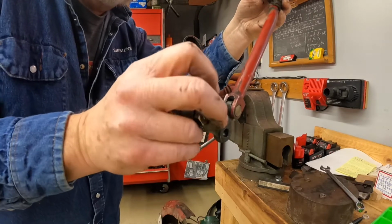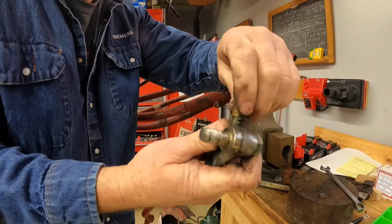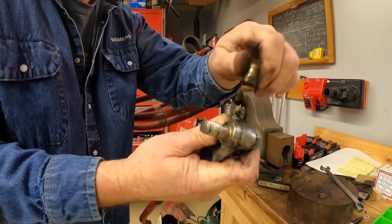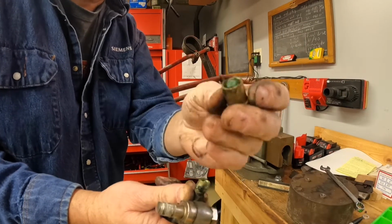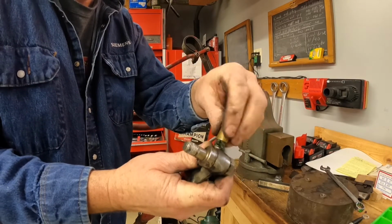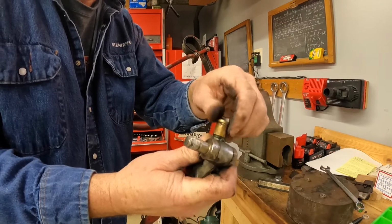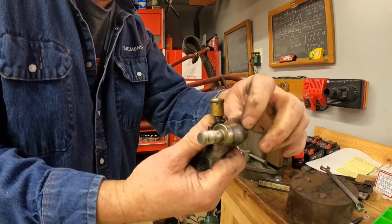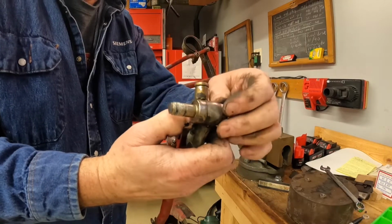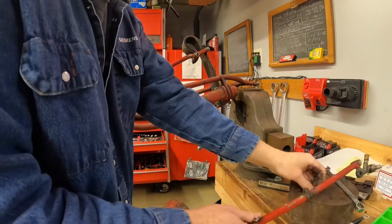This is a grease cup. So you screw that off. Every once in a while, once a week, once a month, depending on how much you ride, you screw that cup off, you fill it with grease. You see it's got some green John Deere cornhead grease in there. And then you screw it back on. And you screw it down, it's got clicks. It's got a little spring in there that clicks. And you screw it on until you see some grease coming out around the pivot, and then you stop. And then after you ride for a while, you might give it another click and put a little more grease in there, and so forth. So, interesting process.